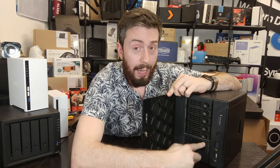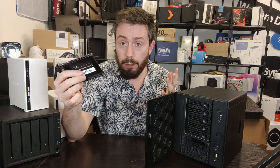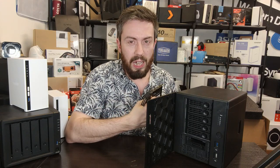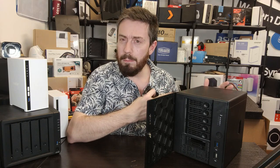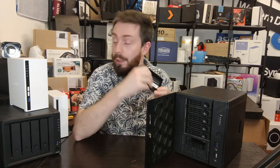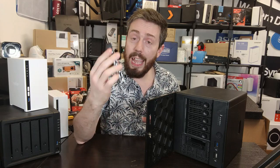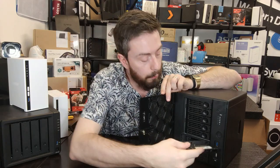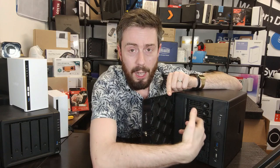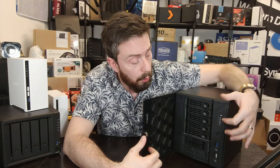On the base we've got two SSD caching bays, though it's worth noting you don't have to use them just for caching — you can use those bays for raw storage. This system doesn't have M.2 NVMe slots, which surprised me in 2022. I believe the system was released around end of 2020, and even then I'd have expected M.2 bays. The drives included are all approved by iX Systems, but you can also get the system completely unpopulated if you choose.